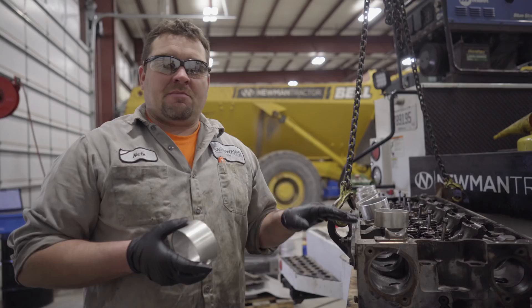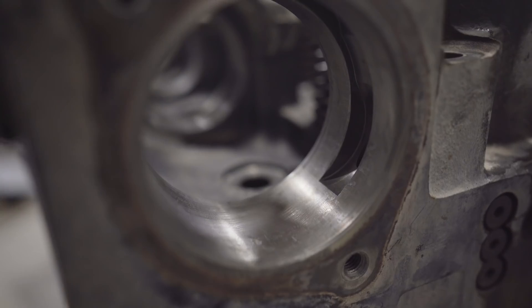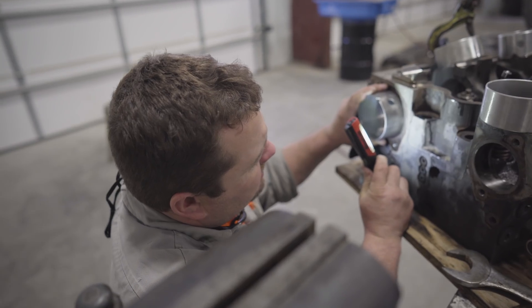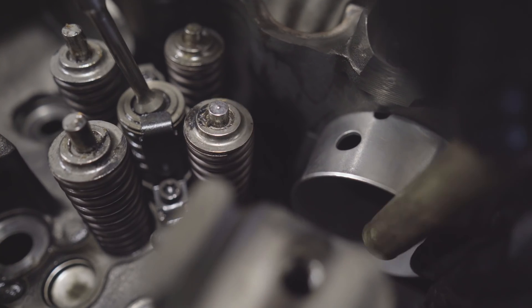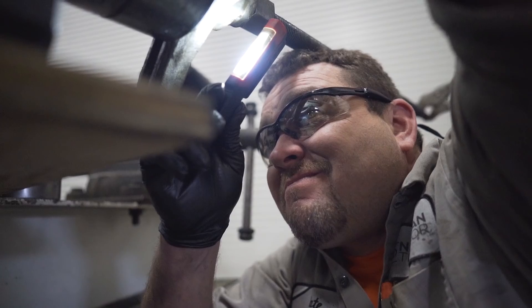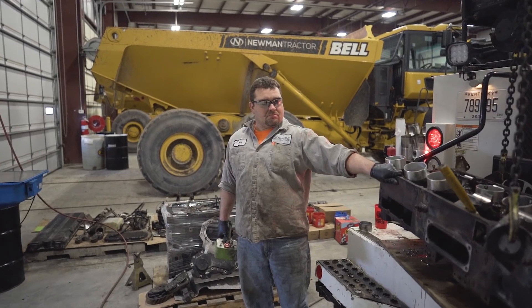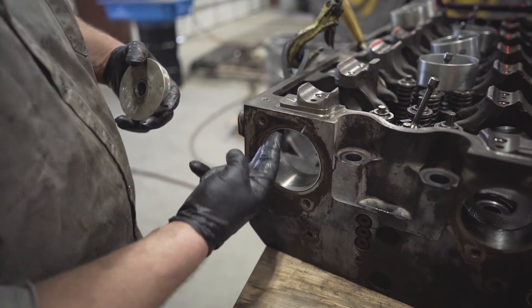You might have noticed that I marked each journal with the bearing — that's to ensure that we put the right bearing back in the right hole. Three of these bearings have holes in them so that they can receive oil from the oil gallery. I've got my marks lined up, and I'm going to take this brass punch and lightly tap this bearing in to get it started. Now we've got our bearings started, we're going to install the sleeve and the puller. It's important to go slow in the beginning — it may be necessary to make adjustments to keep the bearings straight.